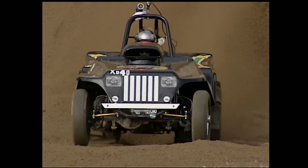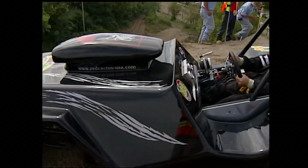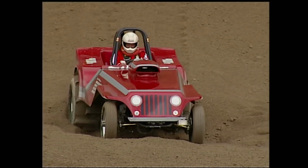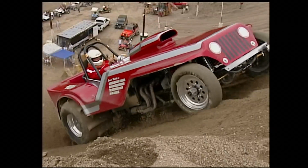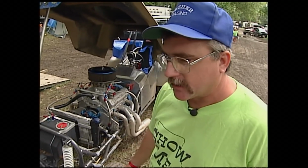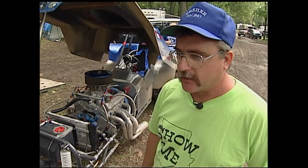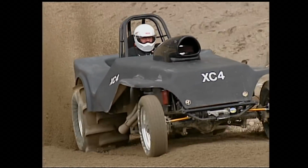If I was just building cars for drag racing, it would be a little different. But the hill, you have to have 8 to 10 inches of ground clearance to peak the top, or else you'll drag so bad you'll get stuck on the top of it. And they've got to be able to handle the pea gravel. Build the frames where they're rigid because the cars are 4-link suspension in the front and rear to make them hook up harder, and on a loose surface they work good like that.